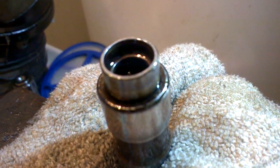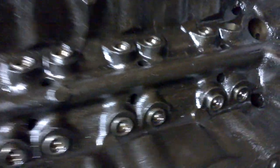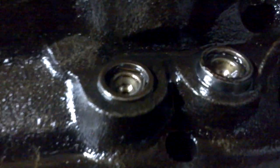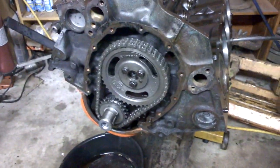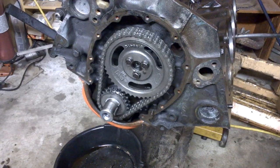This is the part completely apart — hydraulic lifters. Take them apart and clean them because they were stuck, then put them back together. It's not easy to get apart either. This is where those lifters go — some of them are already in, there's one last one to go in that empty space. All of them were disassembled; the last one is in.